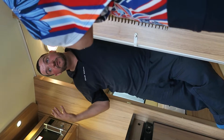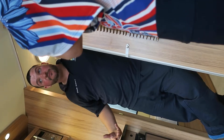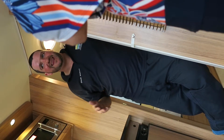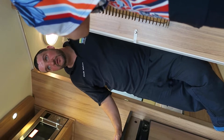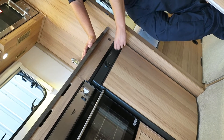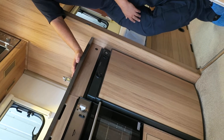The main thing is, if you want to travel with items in your fridge, you need to get the fridge nice and cold first before hooking it up to the car. On your drive at home, either plug it into the mains or light it up on the gas - just to get the temperature down. The vehicle battery just holds that temperature. If you put items in from warm, when you get there it'll probably be only moderately cold. But if you've got it cold first, it will hold its temperature when you're travelling down the road.